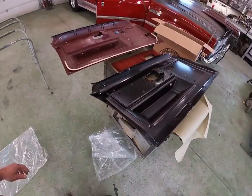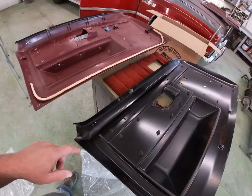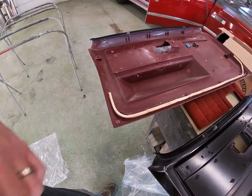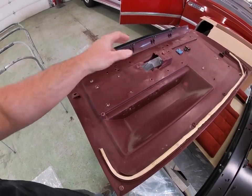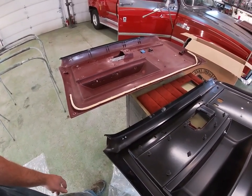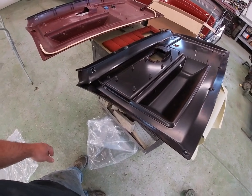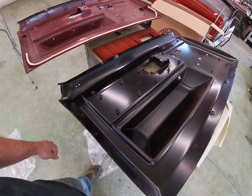So we got these turned over here. I noticed something taking this insert out of the original door panel — these new ones don't have these Christmas tree tabs in them. Should be one here, one there. Again, I don't think it matters, but that was definitely probably a cost-saving measure. I don't think it's going to have an effect on how it fits because this thing's going to go over top of it and fit nice. You get a good bit of fasteners. So it's probably not going to be an OEM fit, but we'll find out. It also doesn't have this little tray for the anti-squeak or anti-rattle strip. So we're going to get this insert out of here, get our window and door switch hardware swapped out, and see how it fits.